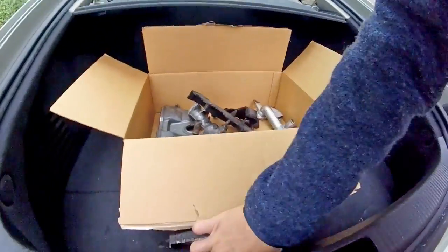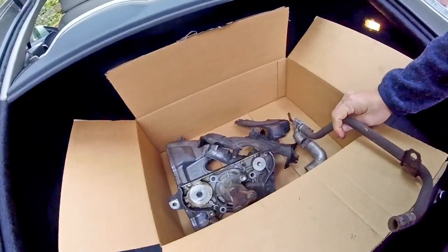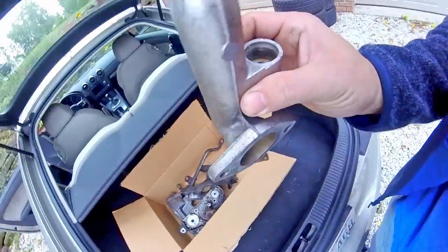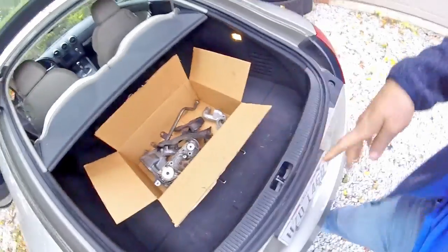We have to find a solution for my water pump block-off. Here's the water pump and here's the neck — it goes on the water pump. I don't have a heater core anymore, so this pipe which comes back from the heater core has to go into the return neck. A lot of people say they can weld it, but I don't like the idea of welding aluminum. We have this huge cavity with which to set something in, so we're going to attempt to machine something that matches this out of aluminum, put a washer on it, and pin it in place — that should prevent any pressure blowout and be a lot safer. So now I've got an hour and a half drive up to Nowheresville, Ohio, but hopefully we'll be putting it all together.